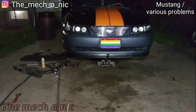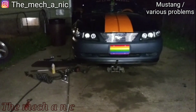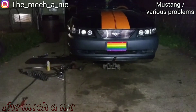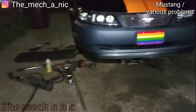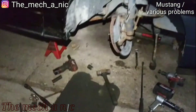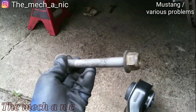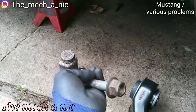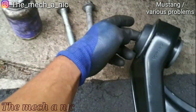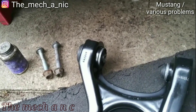I just had a really dumb moment. I'm done tonight, so I figured I'd clean up my tools and close up the windows on the Mustang and park it in the garage. Let's just say it took longer than I like to admit for me to realize — hey dummy, all the suspension is taken apart, this car is not moving. That's how you know I'm tired. I did a quick sandblast on the bolt — it was all rusty and crusty, a little pitted. I'm going to use some synthetic grease on the bolt and inside the sleeves to try to slow down the corrosion next time.